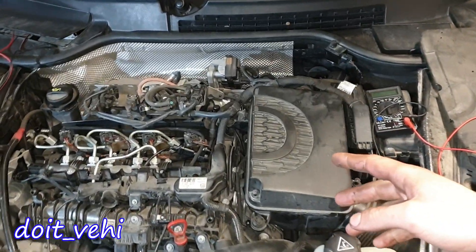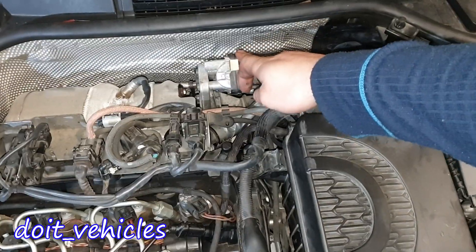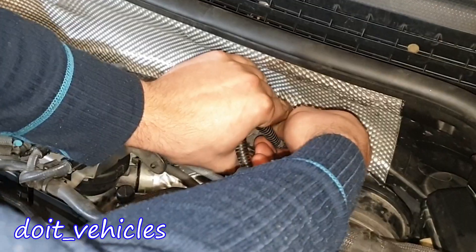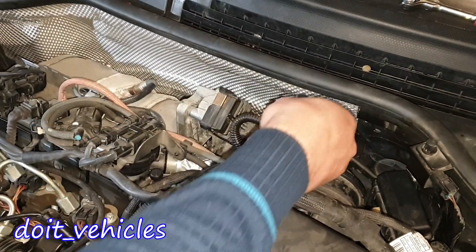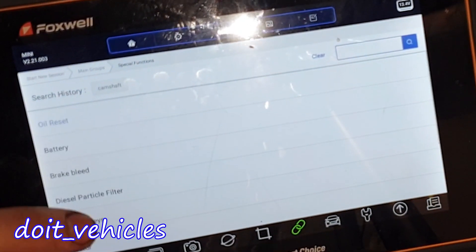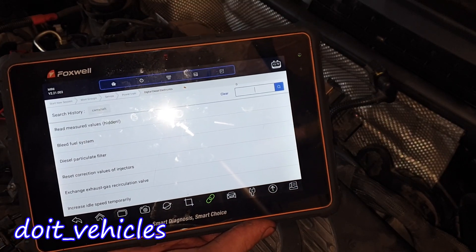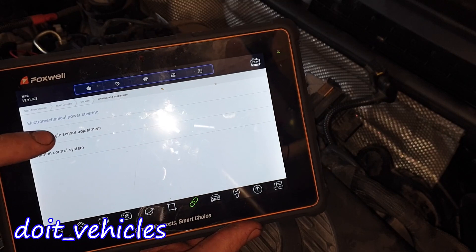In this video I want to quickly show you how to do a couple of tests on the turbocharger actuator. We're going to see the voltage values of the connector — the ignition is on. I was looking to do some bi-directional tests, however the scan tool does not support such things for the turbocharger actuator, so all you can do is use a voltmeter.